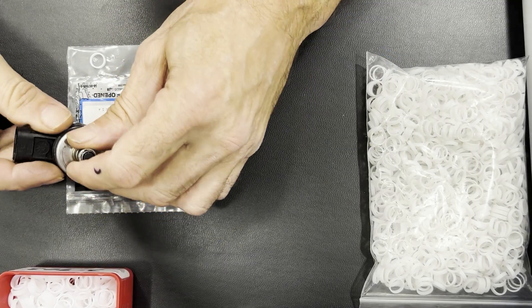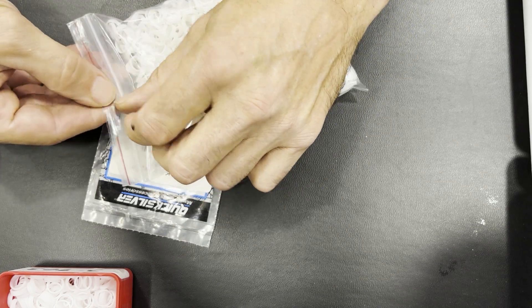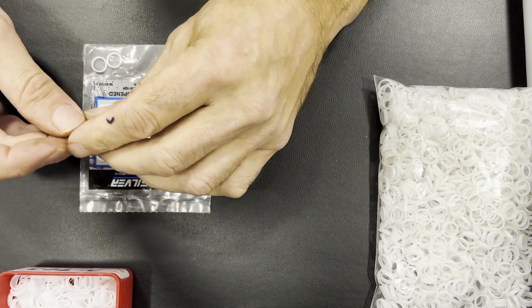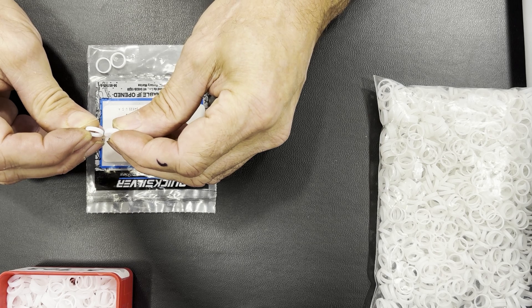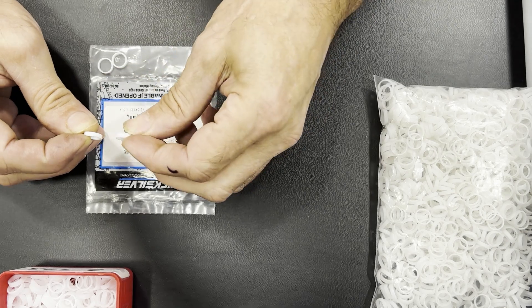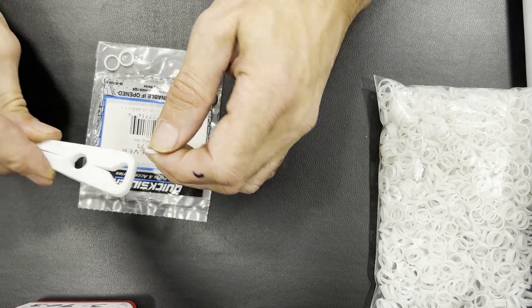So the OptiMax air injector. These Quicksilver seals are the OEM seals — these are the seals everybody uses, bought from many places online, big places, small places, reputable places. These are our seals. You can tell just by the eyeball there's a difference in size. Ours is the same size as the factory seal. Let's take a look at what happens when you use the seals everybody else uses and the standard fitting tool.